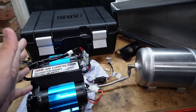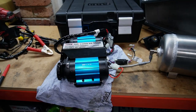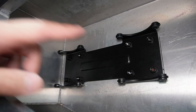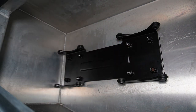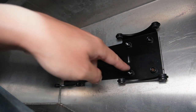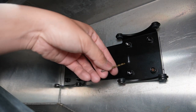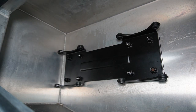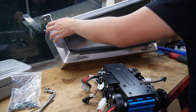Hopefully that gives you an idea of what you're going to need. Next I'm going to take the mounting bracket off and use it as a template to drill some holes. I've got the mounting bracket held in there by just one bolt — because the rivet nut is actually pretty tall you can't mark it with a permanent marker, so I got a little drill bit and made a pilot hole through the rivet nut. Just be careful not to mess up the threads, then drill out the remaining holes.